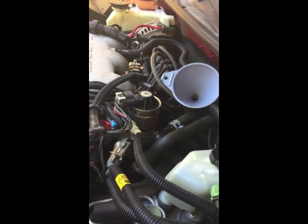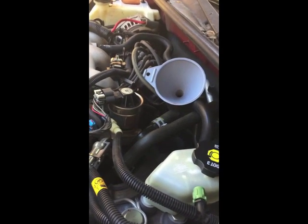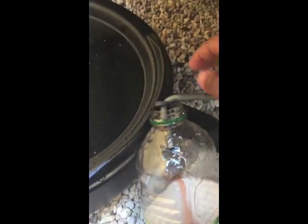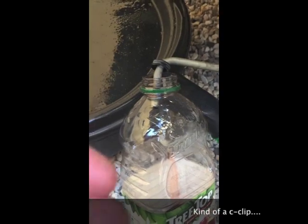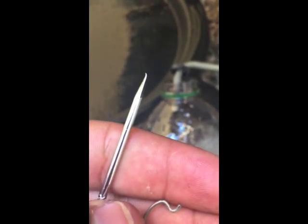Without any really specific tools that I have in my toolbox — I just got my funnel on the transmission dipstick. There are plenty of videos out there on YouTube but I don't have to do one on essentially taking off the transmission coolant line from the radiator. Here's the C-clip that went around the transmission coolant line. I found this little pick — got the job done. I used this side, pulled the C-clip out. The supply line is the bottom one, located directly under the radiator hose.